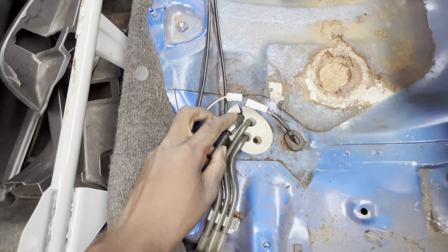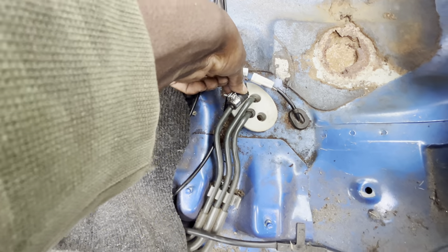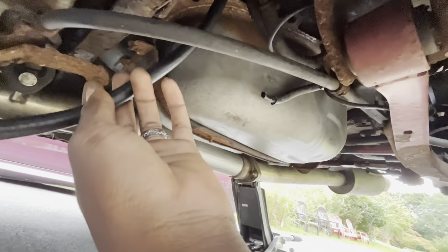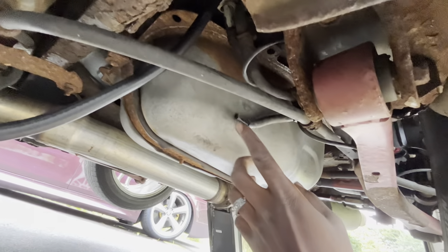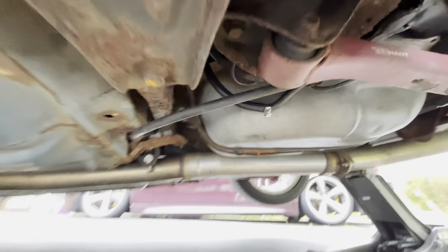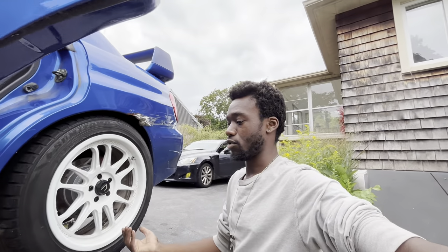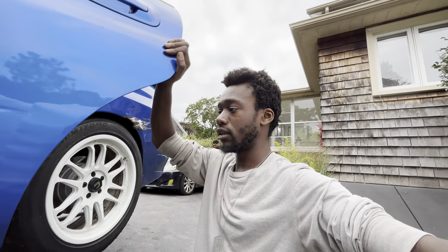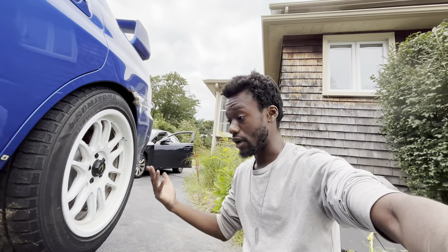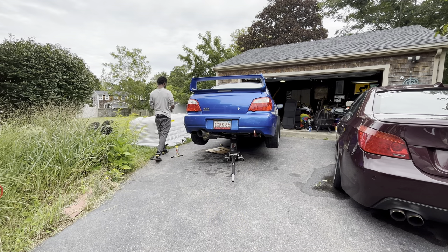It's a little while later — I was lollygagging a lot — but I ended up having some spare fuel hose. I cut where that deteriorated piece was, like I showed before, connected that hose, and now what we're left with on the bottom is this super long piece which we're going to connect right here. That's all fixed. We're going to give her a quick prime, start her up, and see if everything holds. All I really did was replace a metal line with a rubber line — I didn't change the pressure or anything crazy, I just stopped a leak.